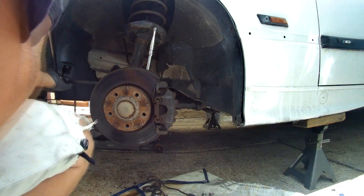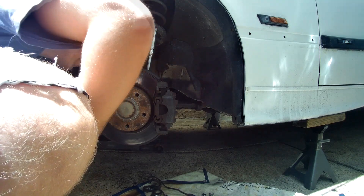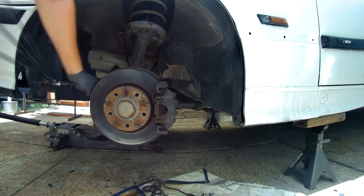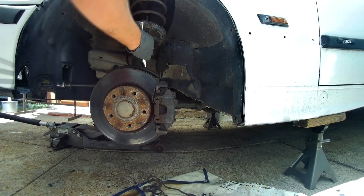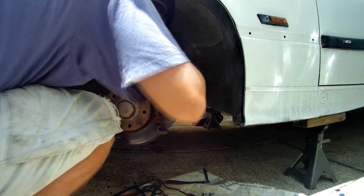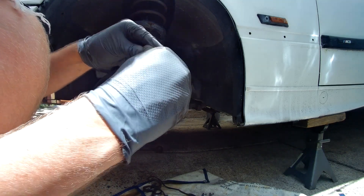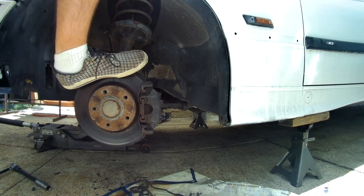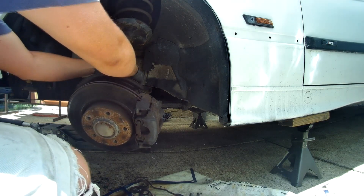I'm going to put the camera down. I have the ratchet there holding one side, and I give the breaker bar a good tug and it should cut loose. Give it a good tug — there it goes. Now that it's out, put the nut on the bolt and put it to the side. What you want to do is give this thing a good kick and pry it off. Now the shock is detached from the hub.